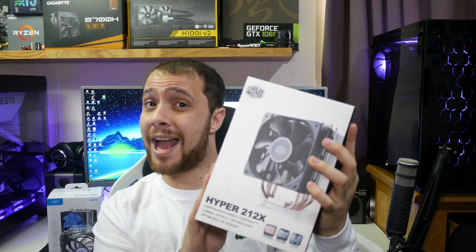So there are the benchmark scores. The Intel stock cooler did do okay, but like I said — big tower case, three fans in the front, it's not exactly hot at the moment, and I did change the paste to Arctic MX4. I know a lot of you in smaller cases with limited airflow are going to struggle to run this with an i5-8400. If you've got an i7-8700, you are going to run into thermal throttling with this CPU cooler. Any of the coolers we reviewed today are definitely going to help you out if you've got a 6-core, but the winner was the Hyper 212X.